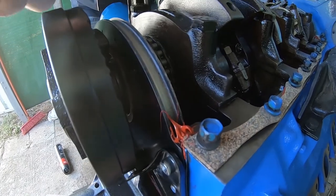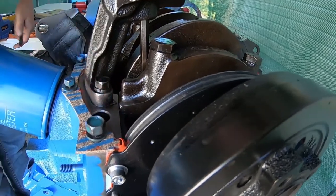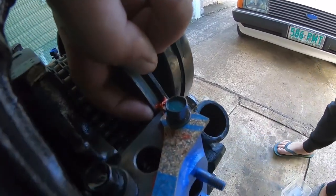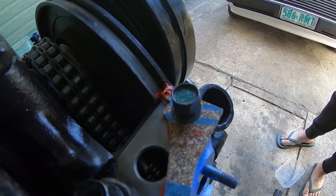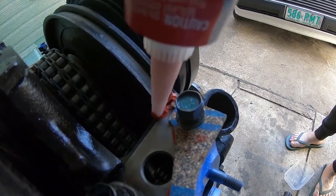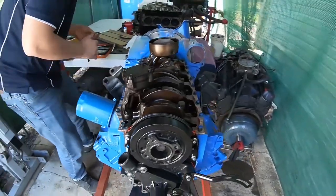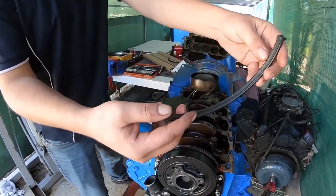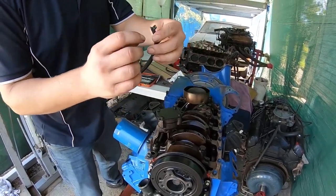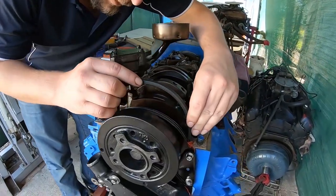This one here — just a little bit on the edge, a blob in there. You might be able to see that the sealing here isn't cut completely flush to the block and it's got a rounded corner, so put a slightly bigger blob in the front here. Now the way the seal goes in: these two bits press into the channels we cleaned before. There's a little channel where the centre of the cork goes, so you put the cork on first and then the rubber seals come in like this.